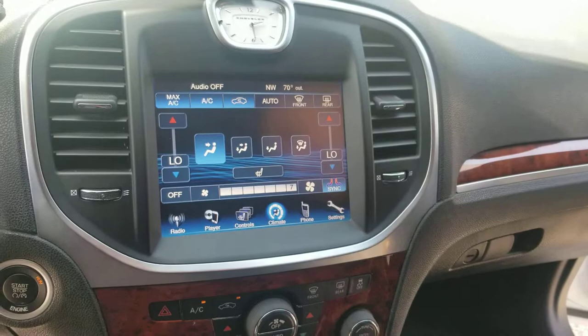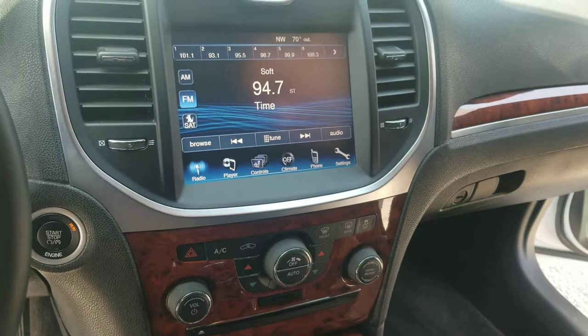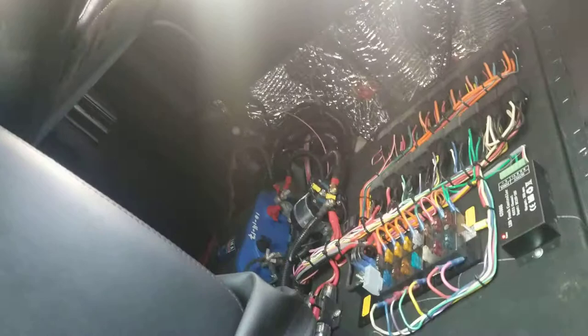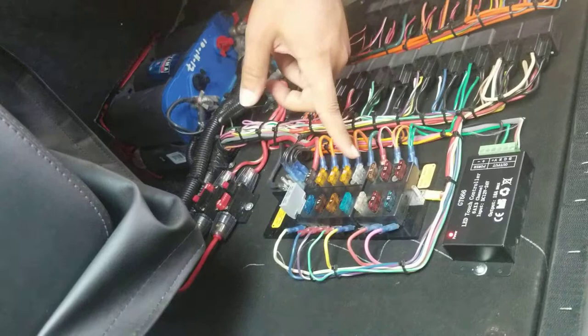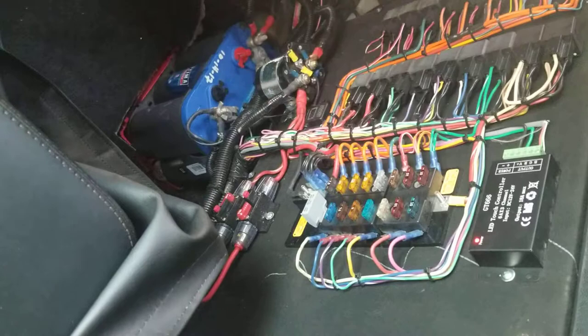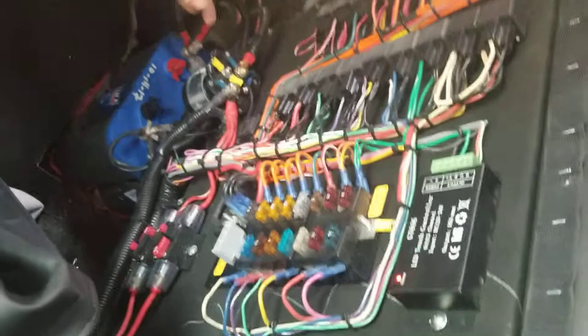It has Bluetooth radio and satellite radio. If I slide this seat forward, I want to show you something very important. These are your relays for the vehicle's electrical components. This is the LED controller box — it controls the lighting in the back. These fuses each have different functions: a light, a stereo, whatever the case may be. If one of these fuses pops and something isn't working in the back, you can come here and check which fuse needs replacing. These are circuit breakers so you don't put too much power into the system — it prevents overloading and wiring damage. This is your solenoid, which protects the surge of power from the secondary battery to the system in the back.